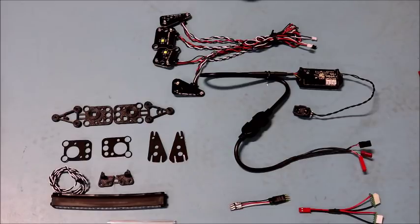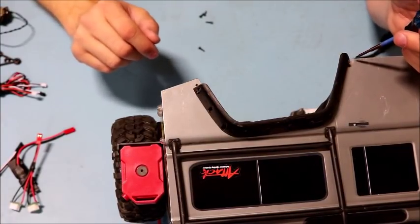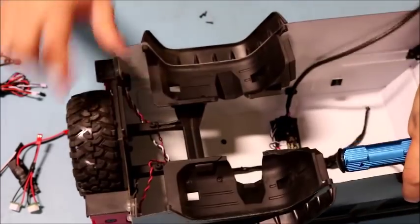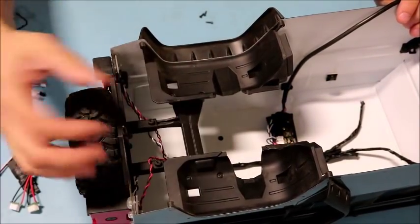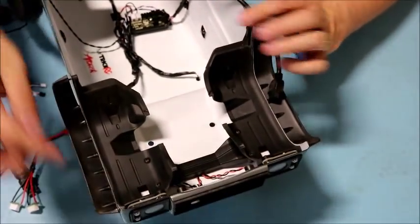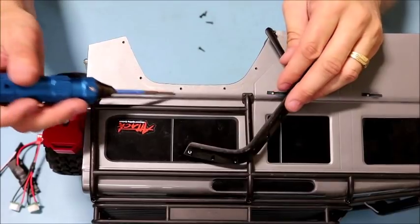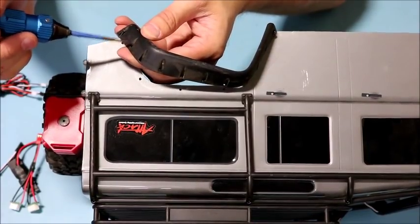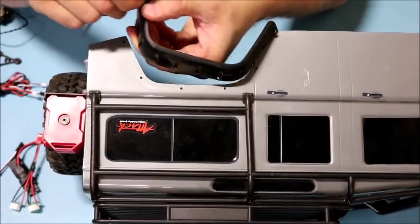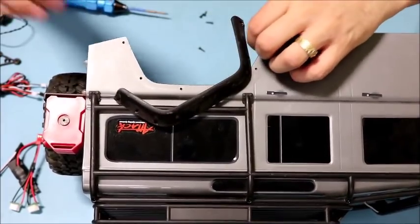This entire kit uses all of the existing hardware on your TRX body. Let's jump into the disassembly. The first step is to remove the wheel fairings all the way around the vehicle. Once you do that, the entire centerpiece comes out. On the rear there are two additional screws, but on the front the assembly just comes right out. Note that many locations that look like screw holes are just dummy filler pieces.